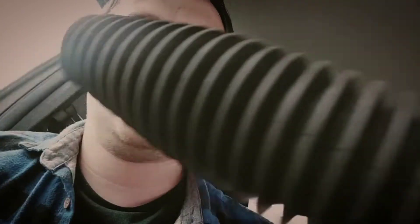So, this is the old steering rack boot we took off — it's split, destroyed, and full of oil. We got this one off eBay. Typically, it's not even close on this end — it's obviously for an E-Class, not an S430. These parts companies like to say it fits this, this and this, but an S-Class is a lot bigger and heavier than an E-Class, so it's probably got a different steering rack.